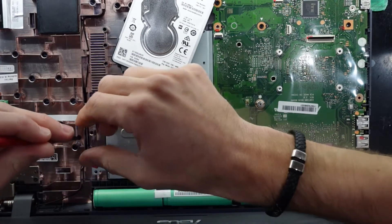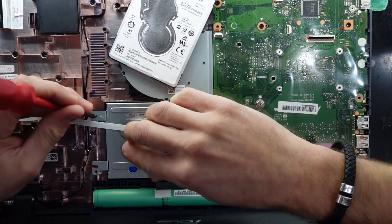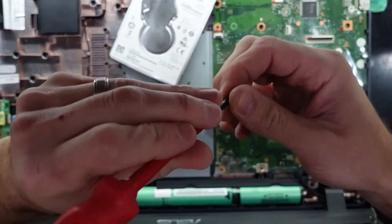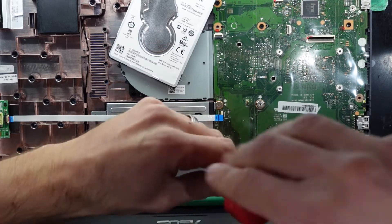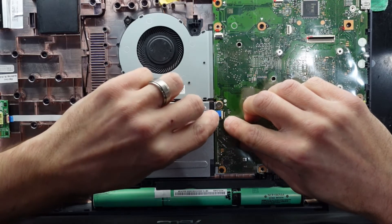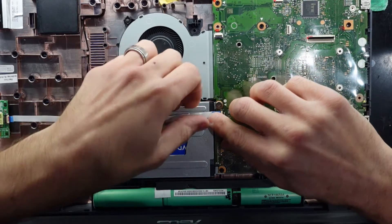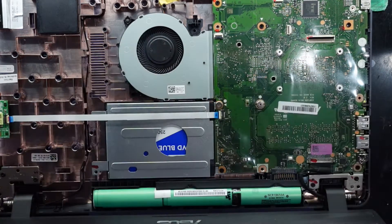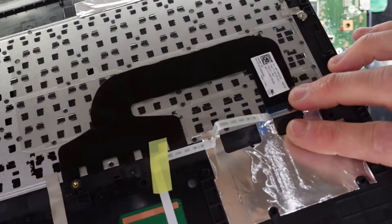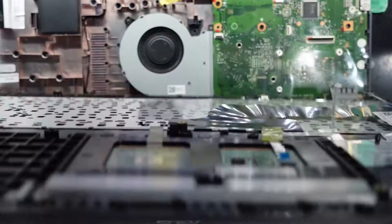So I made a mistake — that needs to go under here. The flex connector lifts up, pull it back. There we go, unscrew it in, move that drive away, connect up the connector — once more it slides under the pins. Push down, and now we've got to reconnect these two connectors right here: keyboard and trackpad.